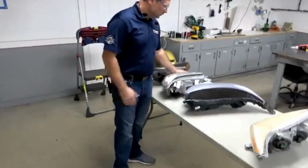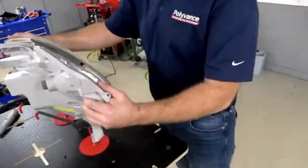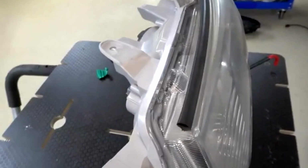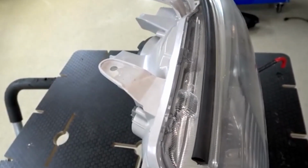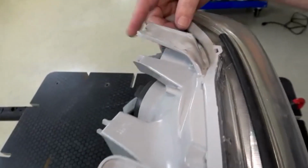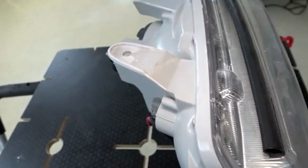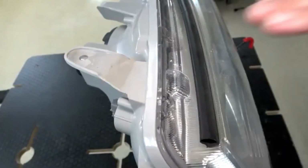So that would take some amount of time. For all of you who may have your stopwatches on in the audience, the welding process is probably part of it, but the refinishing process to make it look original again is pretty lengthy in some cases. So you need to account for that. And this is one right here that is completely finished out. This tab did not require any filler, any primer or anything. We were able to repair this tab. And again, it was broken off just like this. The end was missing off of it, and we fabricated and built the end of this tab back on, and sanding and shaping with the welder is all it took to get this tab this close.